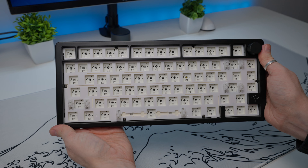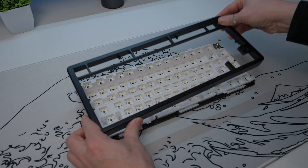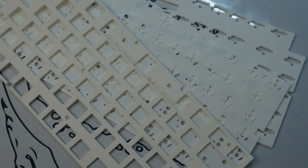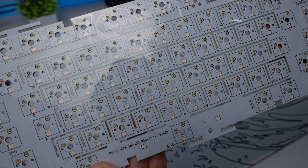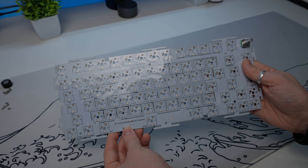It's time to perform a teardown to showcase the internal structure of the keyboard. To get inside the board you'll need to uninstall your keycaps and switches before finding a series of hidden inner case screws. Upon removal the top case housing should lift away revealing the internals. Make sure to unplug the connectors on the back before you go any further. The TK75 Pro comes with 5 layers of sound dampening foam. It's rocking a polycarbonate plate with plate-mounted stabilizers and some fairly light flex cutting. The PCB is 5-pin hot-swappable with side-facing RGB LEDs, and you're getting a lot of flex cuts which really limits the foam configurations you can perform. Though I don't think it's a really big issue because I really enjoyed the stock sound profile on this keyboard. In the bottom case you'll find the 4000mAh battery as well as the gaskets I mentioned earlier.